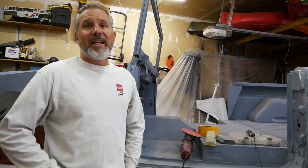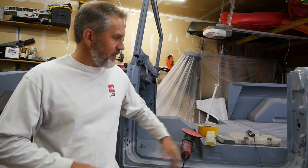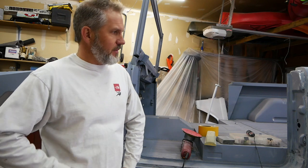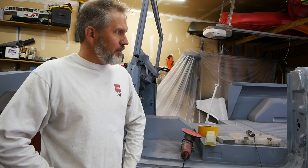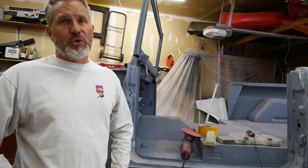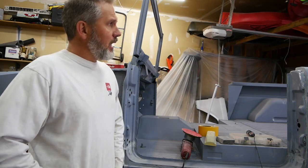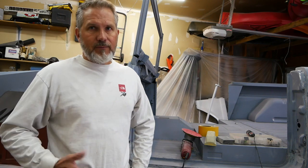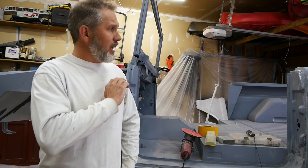It's primarily 80 grit I'm using, 120 grit to roughly shape things. I've got some 40 grit sponges just to knock the high peaks off the body filler I put in. The aluminum-infused body filler is extremely tough to sand, so that 40 and 80 grit works really well to knock it down before fine sanding. I'm going to finish with about a 400 grit before going back to epoxy prime.